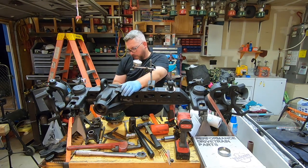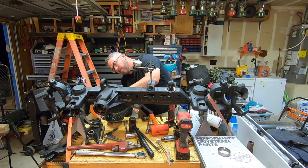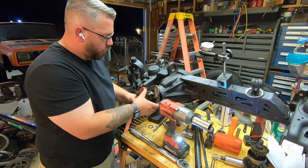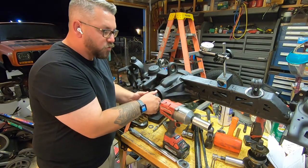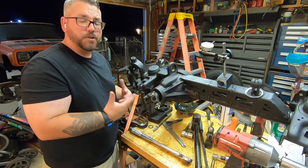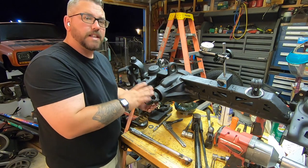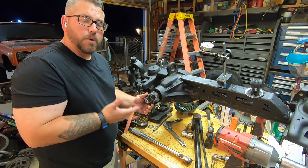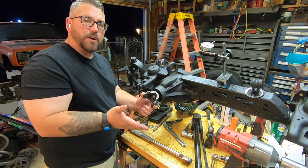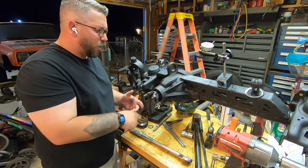Since this is going to be the last time I pull it apart, I'm going to go ahead and install the new race — I'm just going to carefully tap it in. Let's slap her in there and hopefully we have a good preload. My goal is to bring it close to the point where there's no movement and then slowly torque it more and more until I meet my preload goal. The torque on this nut is probably about 200 foot-pounds, but my torque wrench doesn't go that high, so I'm going to run it up to 150 and then one last little bit of tightening once the time comes. I'm going to slowly add torque, check my preload, add torque, check my preload — that way I don't over-torque anything.